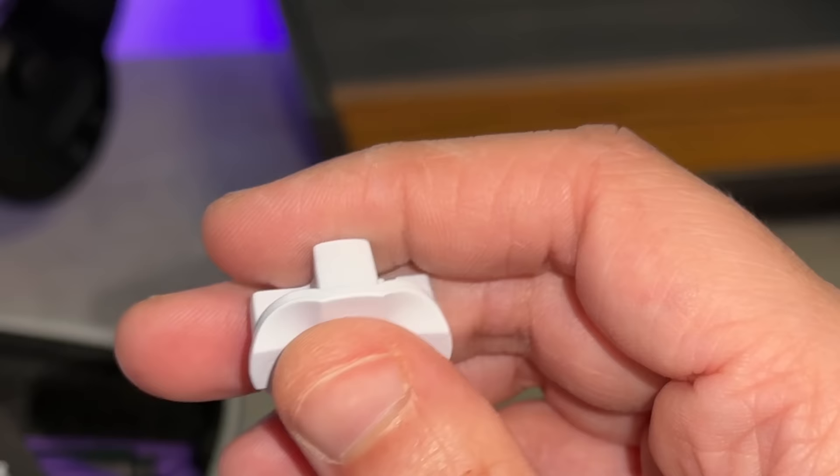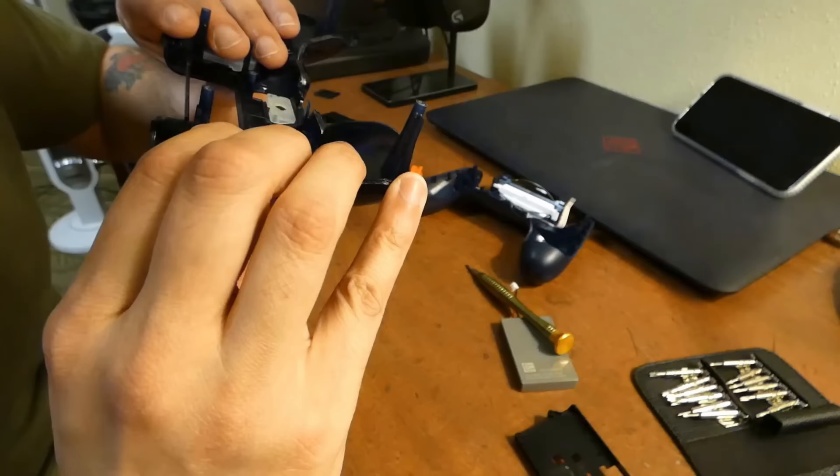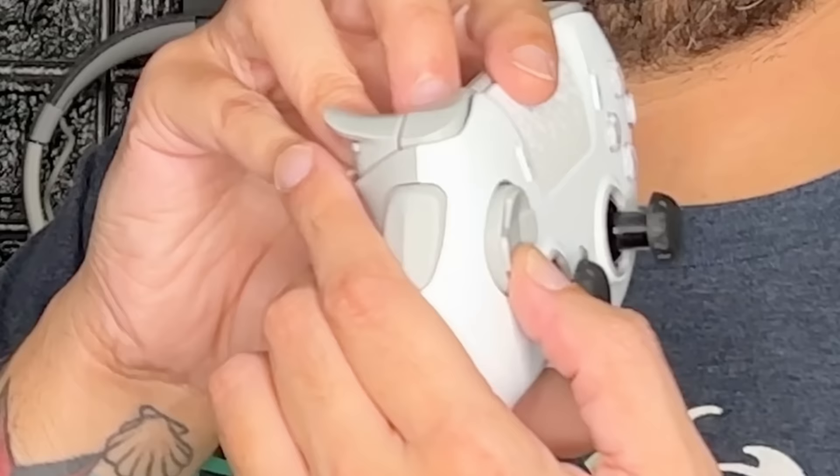If you have any issues, there is a two-year warranty on this bad boy. As for the D-pads, I did mention I'm not a huge fan of the second included option — I'd like it if that was just a typical four-point like most other pro controllers, as opposed to that 'squeezed tube toothpaste got melted in the microwave' look and shape. The one that's pre-installed looks and feels the best. The D-pad and face buttons are high-response elastomeric membrane switches. The actuation of the D-pad isn't the most satisfying — it doesn't give you any tactile click in any of the four directions and there are no separate diagonal gates.